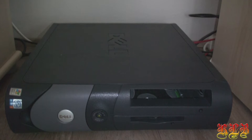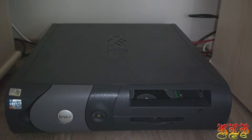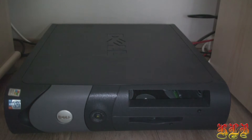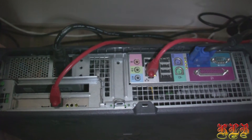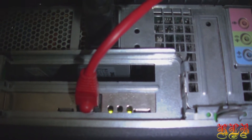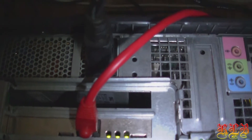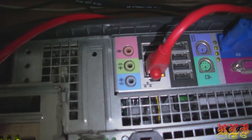I for instance use this old Dell computer — it's now around 10 years old. When it comes to the CPU, you want to be able to run your PFSense machine 24-7, so make sure your CPU doesn't use too much energy. Don't go for a quad core but rather a dual core solution. If energy consumption is really important to you, I would look for an Atom processor.